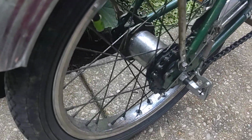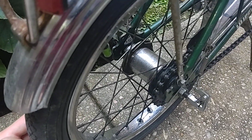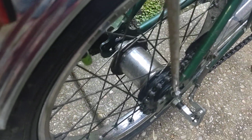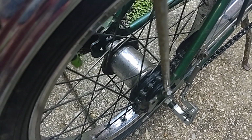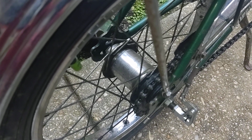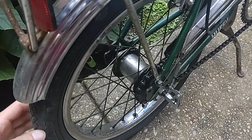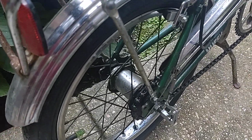Well, it's not a derailleur. All the gears are inside. They're sealed from the elements. This supposedly will last 50,000 or 100,000 miles with just adding a few drops of oil every year. It's surprisingly easy to maintain. I think really the hardest thing is getting that bell crank and cable adjusted properly. Anyway, so very easy to repair, very reliable, good as a commuter bike.